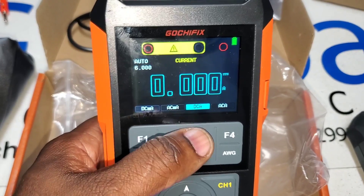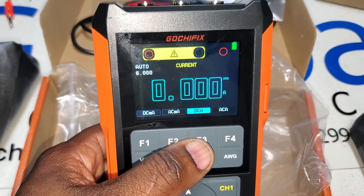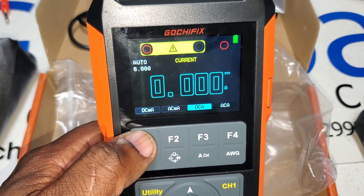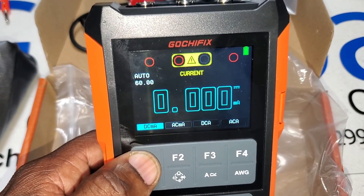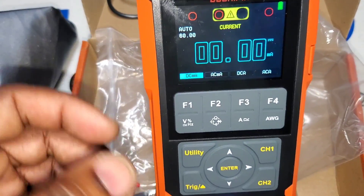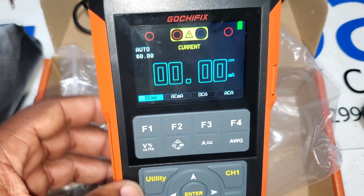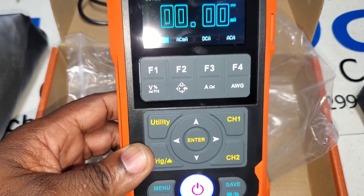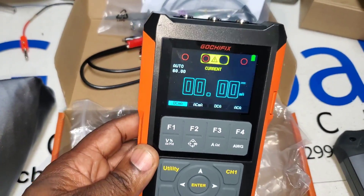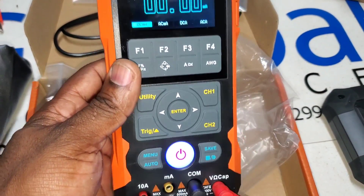When testing larger values — like a battery drain or parasitic draw issue — you'd want to be in DC amps. If the vehicle is in sleep mode you'd drop down to milliamps for finer detail. As you know, on this channel we look at tools from an automotive perspective. I'll say this: if you bring this thing out on any job site, everybody is going to be impressed. It does not look like a toy — this is the real deal.